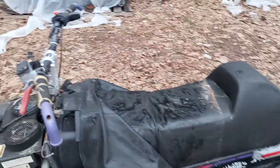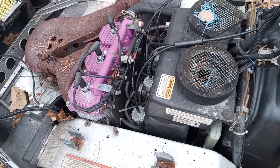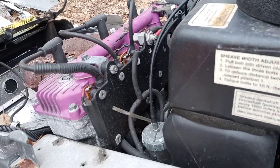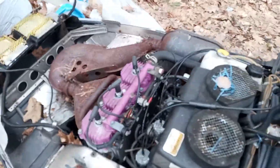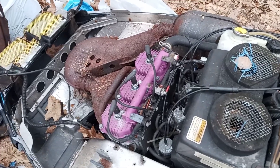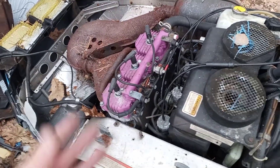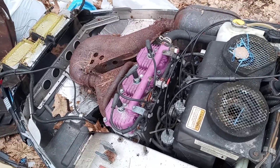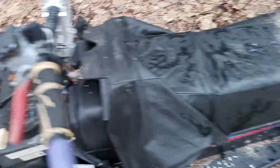Whatever engine was in that thing leaked several different fluids. Over here is the engine I'm planning on using — this is a 97 Ultra going into the 96 chassis, and I'm hoping it'll drop in without any weirdness. It does turn, it's not seized. I've run this engine twice — once when I first bought it to hear it run, and once when I got it home. I stopped there because it has bad motor mounts and was moving around too much. I didn't want to crack the case. It had 120 psi compression across all three cylinders, so I pickled it in oil and it's been covered since.